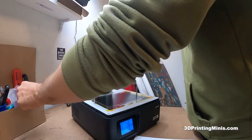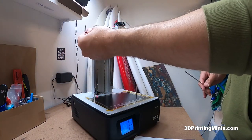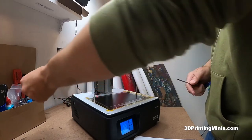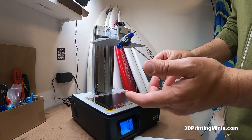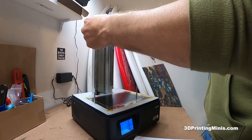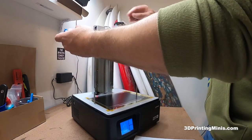The Sonic came with an Allen key for loosening the screws. It's a little short, it's got the little weird ball thing on the end. I don't like Allen keys like this — I feel like they strip parts out more than they help. So I went online, I'll put a link in the description. I got one of these — it's a 3mm Allen key wrench. All we're gonna do is loosen all four of the screws.